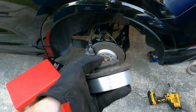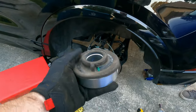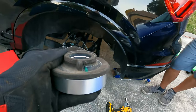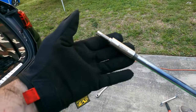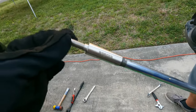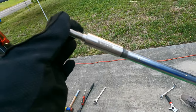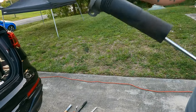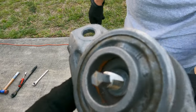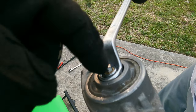Rubber isolator's out, the plastic thing is thrown in the bin. The B2B spacer faces up when it's in the car; the spring is going to go on top. Now for the shock extension: it comes with blue Loctite that you put on the threads underneath. Tighten this down — it's a 7mm. If you've got rubber or something to protect the top of the strut tube, clamp it down with a pair of vice grips and tighten it down. The blue Loctite should hold everything in place. Then the bump stop, dust boot, and top strut mount go on — it is tight, keep that in mind. Use your 16mm offset head wrench on their 7mm socket and tighten it down.